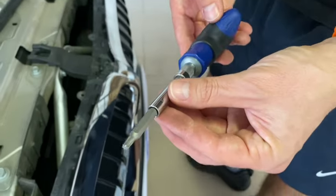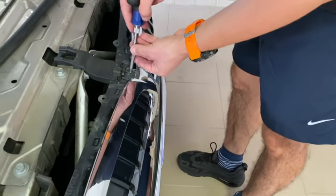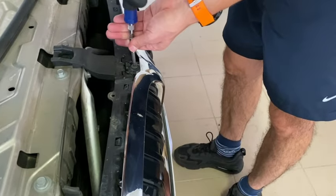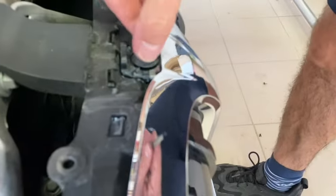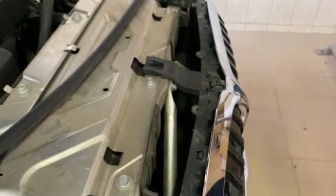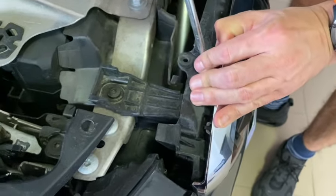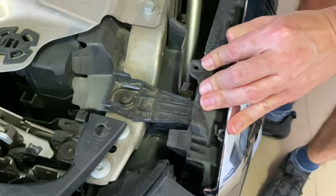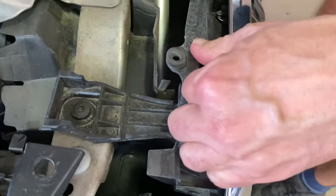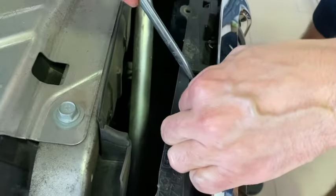Now we are changing the tool - you will need a star-shaped screwdriver. The first step is to release the screw in the middle of the grille, take it out. Then, as you have seen on the F5 series, the same three plastic holders are here and you need to release the front grille carefully out of these.